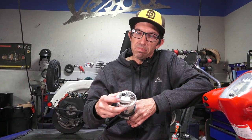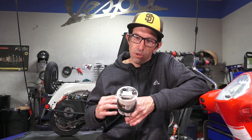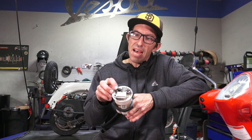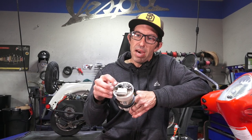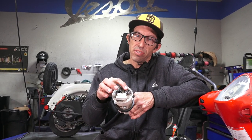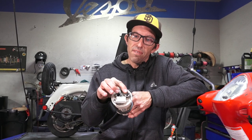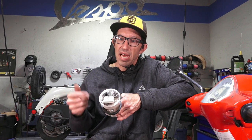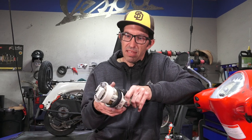On top of the fuel pump there's an electrical connection. Sometimes they have a fuel gauge integral with the fuel pump hanger. The earlier models have a supply and a return — so depending on the model, this would be your supply and this is your return, a two-hose version. All the newer Vespas and Piaggios just have a single dead-headed single-line system, but similar components inside the fuel pump.